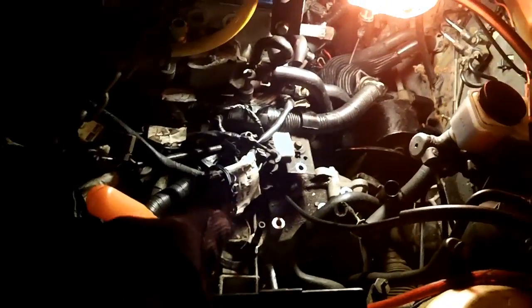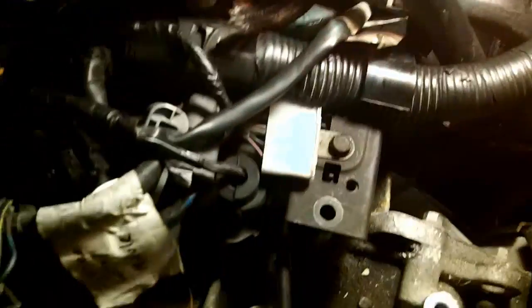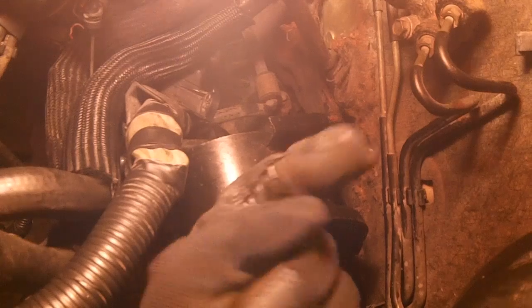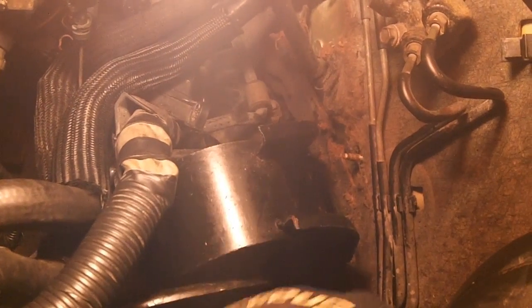Just keep going up, and then just keep going back down there, and go side to side kind of thing, and pry that up. And then I have the jack underneath the transmission. I don't have a transmission jack, so if it does fall, I don't know if it's centered, so just pray, I guess. Come on. Why does it feel like it's catching on something down there? It's catching on that bolt, that stud. That same right stud being a pain again. Because that stud sticks up farther than the other 2, I believe. Takes a little bit more effort to get up, but there you go. No, it looks to be about the same height.